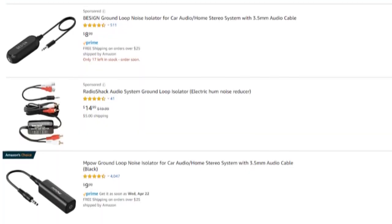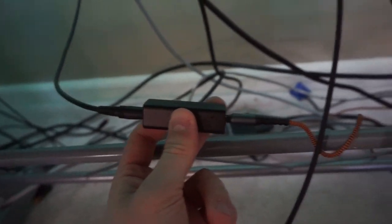All you're going to need is one 3.5 millimeter cable. However, a lot of people — including myself — when we did this originally were getting a lot of feedback in the headphones. After doing a little research, I figured out that because of the way we're listening through the computer to hear the game, you'll actually get feedback from your monitor. If you run into this issue, what you're going to need is a super cheap device called a ground loop isolator. You can find these on Amazon and eBay for like $10 — I paid $8 for mine and it worked great. Put that in line with the 3.5 millimeter cable and all of the interference will be gone. I'll leave a link in the description. Don't go for the absolute cheapest, but keep it under $10.